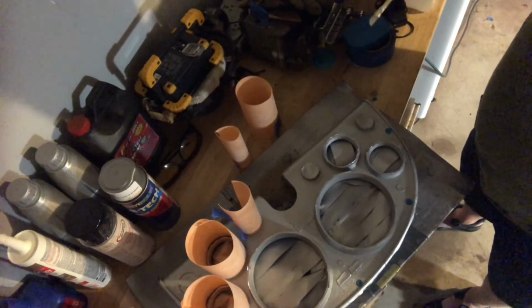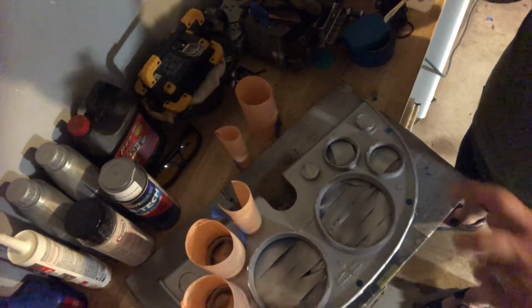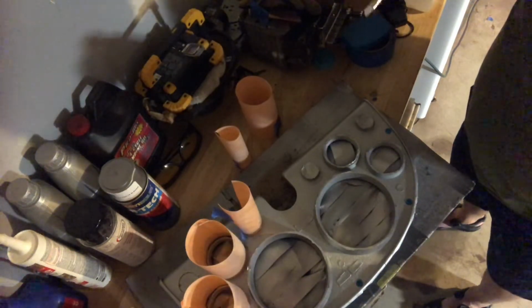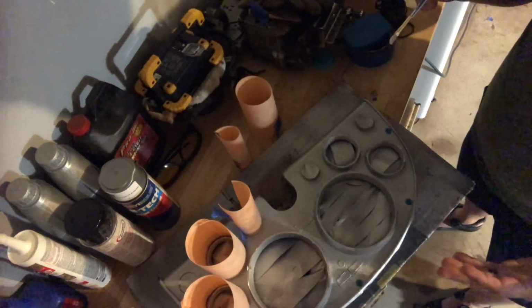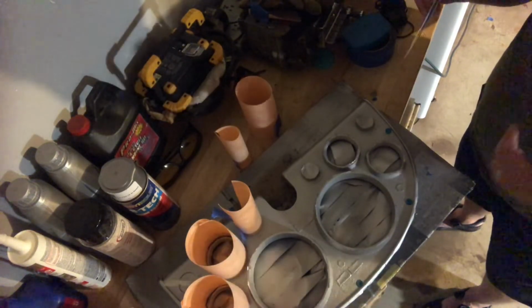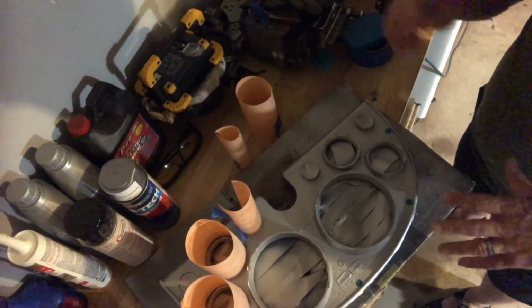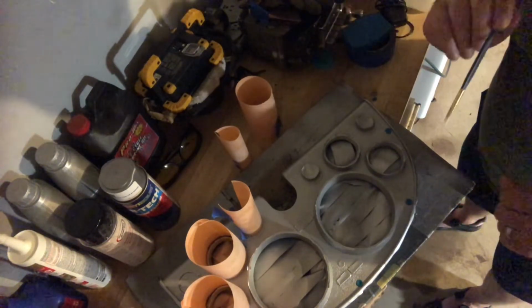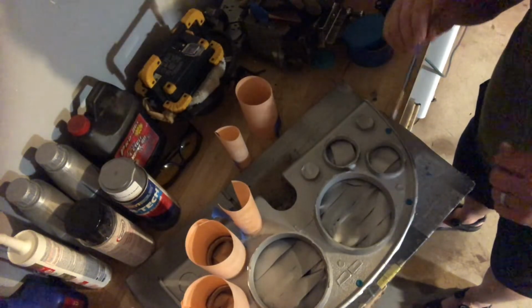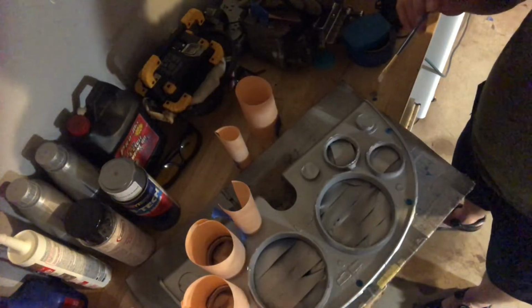Now, one thing I learned watching some videos on how to restore rims, you know, steel rims with black paint or any paint, is that the person coated the tire with Armorall, you know, that wet tire spray that you'll find at the automotive parts store. And I found that to be interesting to maybe use the same concept here. What I don't want is, when I have these on, they're not going to always sit perfectly, so there's the opportunity for the paint to get on the bezel, which I don't want. So I'm taking the opportunity to paint on some petroleum jelly around the base of all the dials, because I believe when I paint it, I'll be able to wipe off any paint that's stuck on the petroleum jelly versus on the paint of the bezel.